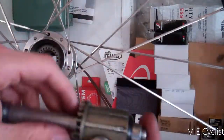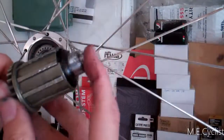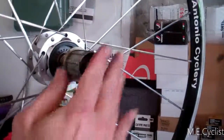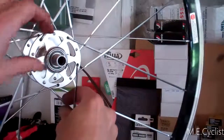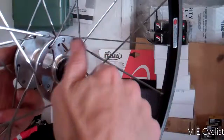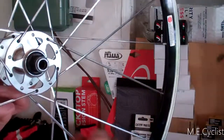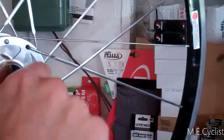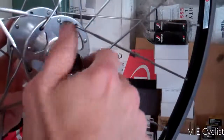If you wanted to replace your bearings, you just swap them out. This would slide out and you pull the bearings out, put new ones in if needed. Put it back together, put your bearing back in the wheel, then put the freehub back in. The bearing on the other side will be pushing in flush. On this side, get your nut and put that back on. Then tighten it back up — super easy to do. The only thing tough is setting the preload. Manufacturers usually have good instructions: tighten until it touches, then back off half a turn, then tighten up the outer nut.